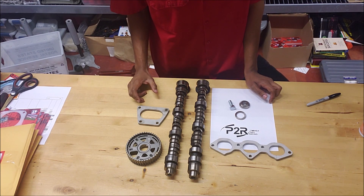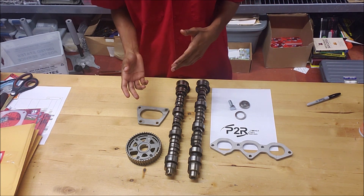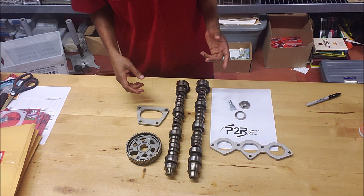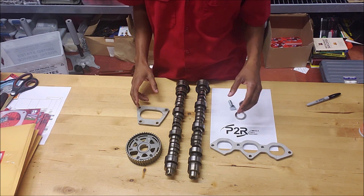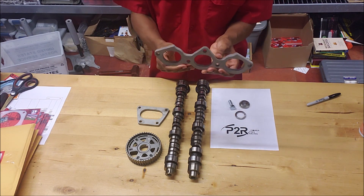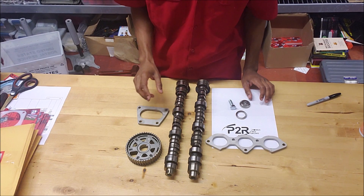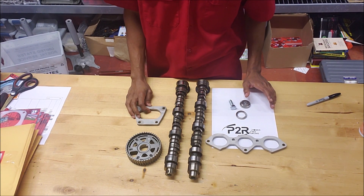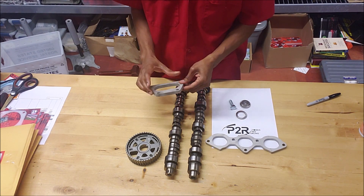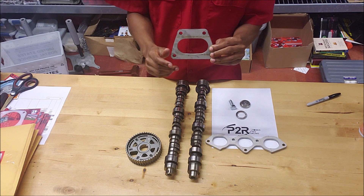One simple way to figure out which engine is which — because a lot of people are confused about which one they can swap into their car — is the exhaust manifold. The most simple way to understand if you're dealing with a first generation engine: you're going to have a typical three-port exhaust manifold with a normal header flange. Starting in pretty much 2004, almost all the J series from that point — except for like the Honda Pilot J35A4 — have the exhaust manifold cast into the head, with just one pipe coming off the cylinder head.